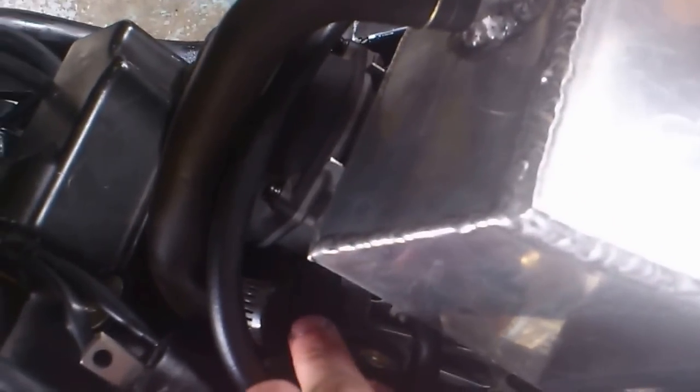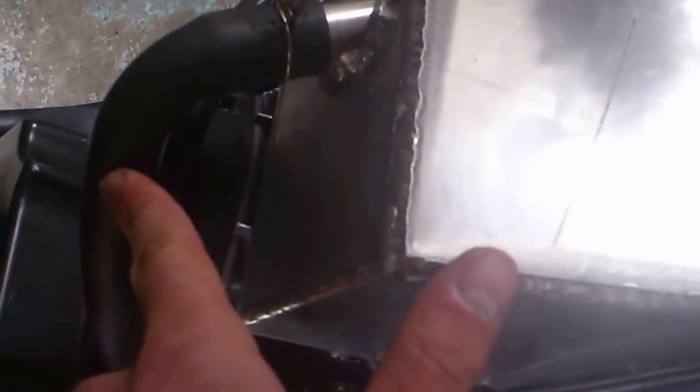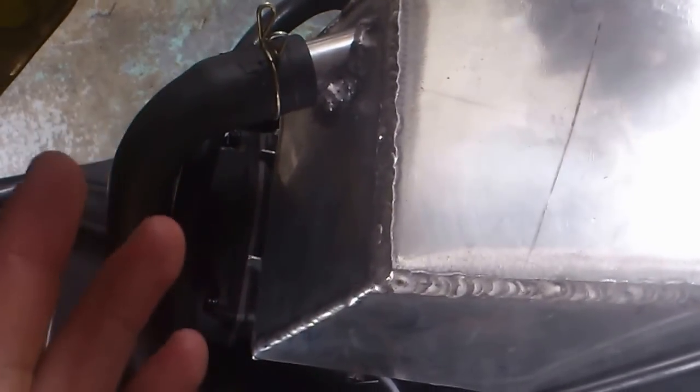Basically the carbs internally can just stay the way they are — you just have to move some tubes around. There is this pipe here that pressurizes the slides, and this applies to all carb motorcycles. When the boost hits, it helps the boost mix with the fuel and go into the engine. This pressurizes the slides typically between 3,000 and 6,000 RPMs, though each motorcycle is different.